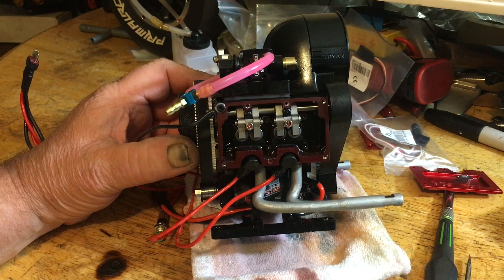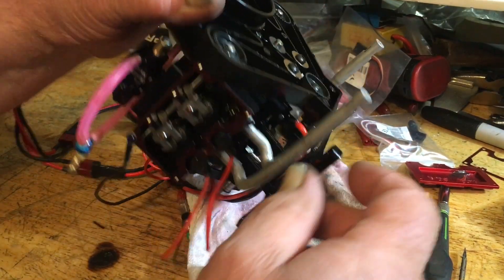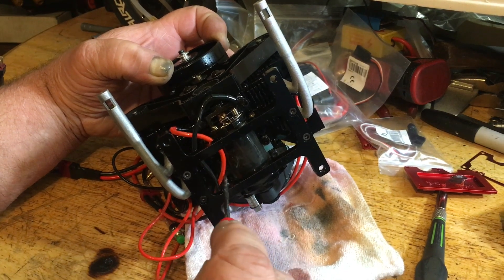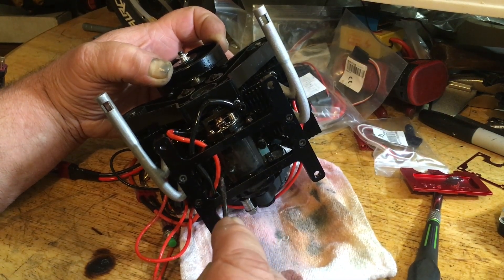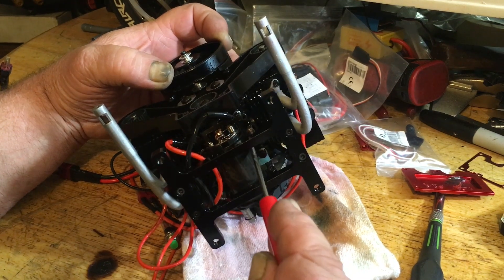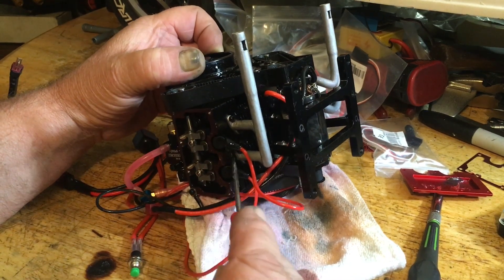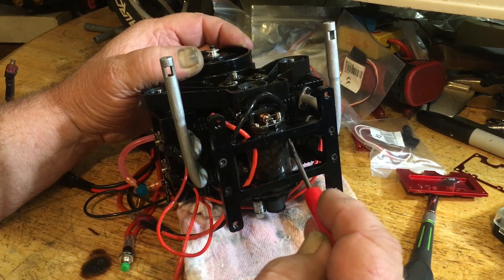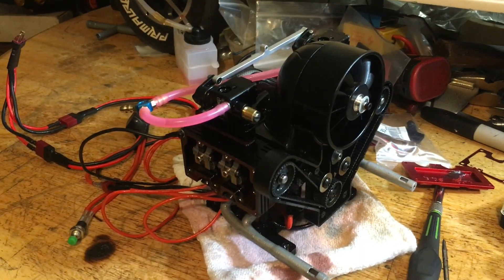I'm glad I already figured out the timing. I also noticed there are actually two crankcase relief nipples - one was hidden behind the starter wire. This expels extra oil from the crankcase that lubricates the crankshaft. Between that and needing to double up the gaskets on the headers and running two tubes off the crankcase into a proper drain system - that was part of the leakage problem.